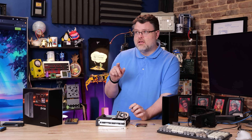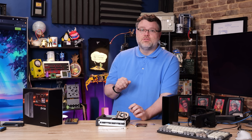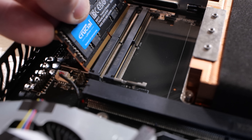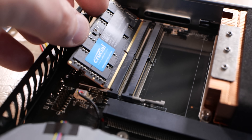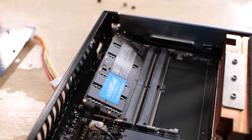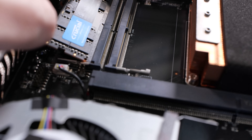The Dual 48 is much less expensive than the Dual 64, and 96 gigabytes of memory is almost as good as 128. So unless you know you need 128 gigs, you're probably fine with 96 gigs. The only other trick with installing DDR5 is making sure you get the DIMM inserted all the way — you shouldn't be able to see the gold contacts, or only see just a tiny bit.